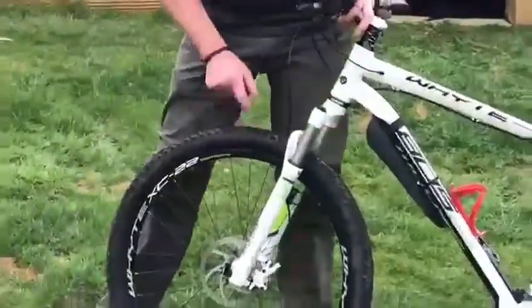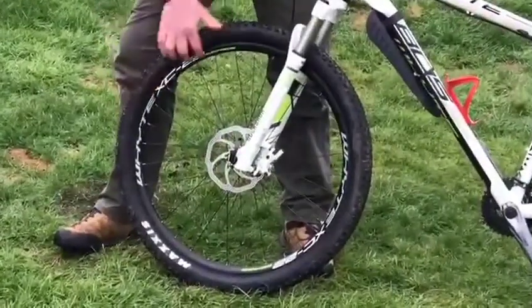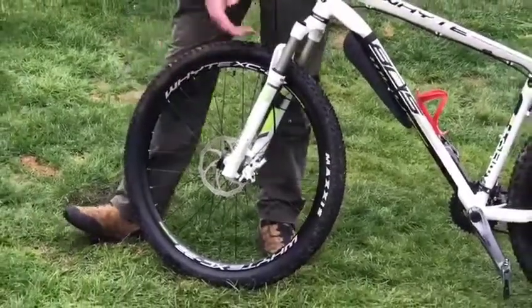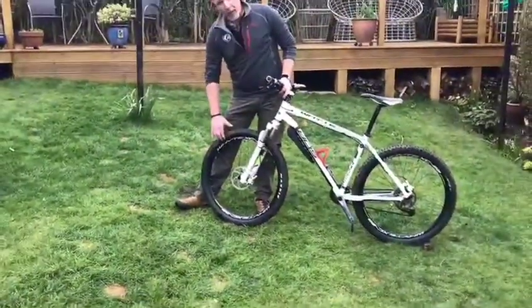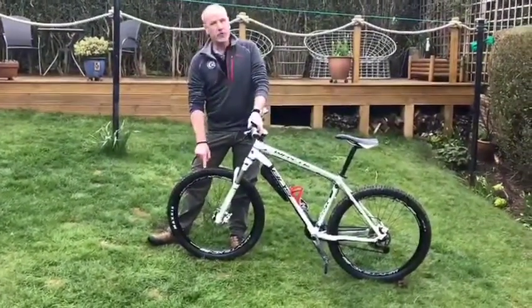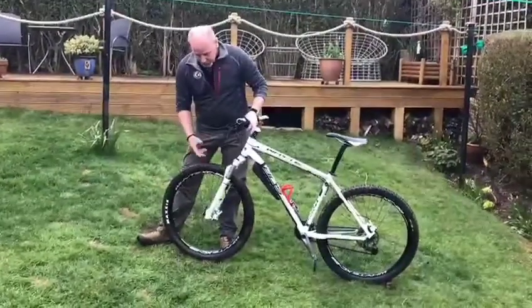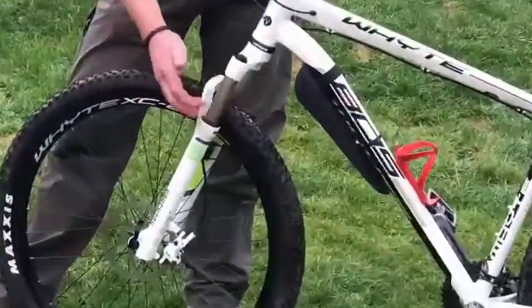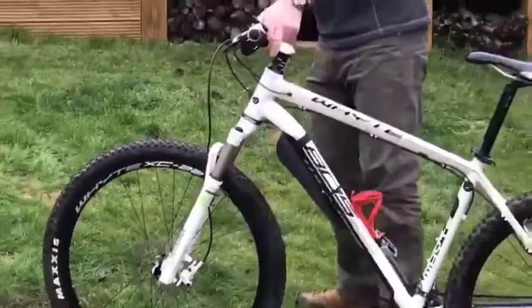Next thing is checking your tyres. We're going to check the sidewall of the tyres and the rim of the wheel as we go around — just give it a spin. Make sure there's no holes, no tears or rips, or really worn out parts, all the way around the whole tyre. Also make sure we've got good tread on the tyre, and do that on both sides. From here, we're also going to come up and check the forks — make sure there's no bits of oil dribbling out, because your seals might have gone and you might need to get that checked out.